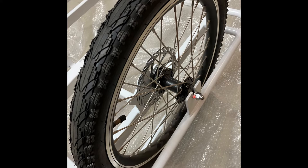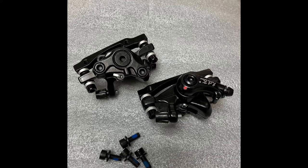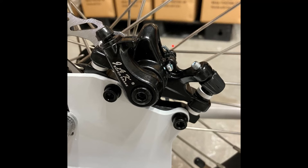On this side you've got a safety washer, a washer, and then a nut — and on the other side you've got exactly the same. The safety washer gets positioned into a hole in the frame, then your normal washer, then a nut. Leave this finger tight for now, because when you flip the frame over and gravity is pushing it down, you'll go ahead and tighten the wheels correctly. These are your front disc brake calipers — left hand side and right hand side — with four screws, two used in each. They'll only go one way, so if you can't get it to fit, try it on the other side. A bolt goes through and holds everything in place, with nuts left loose for now to be tightened later in the assembly.